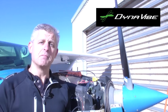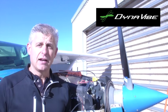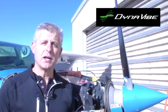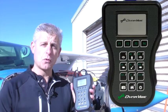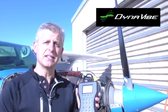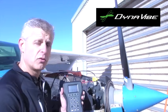So we're here today to balance this prop. Propellers are generally statically balanced when they come out of a propeller facility, but once they get into use, you also want to dynamically balance them. What that means is that while it's running, we use this Dynavibe analyzer to see the forces happening at different orders of magnitude and identify what propeller imbalance is doing to the vibration of the aircraft. Then we make adjustments by putting on counterweights in order to make a correction.